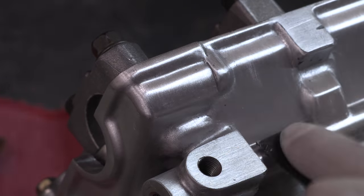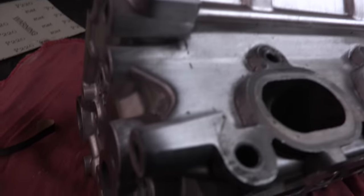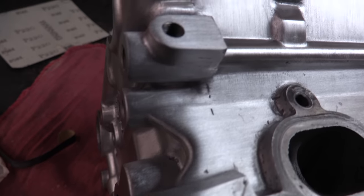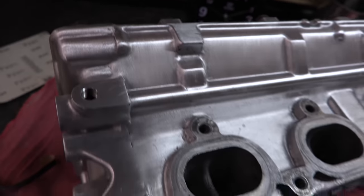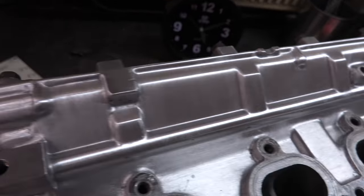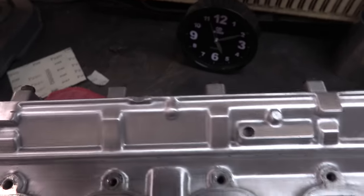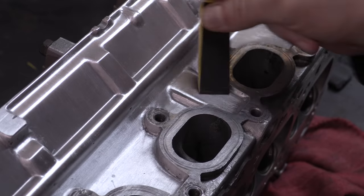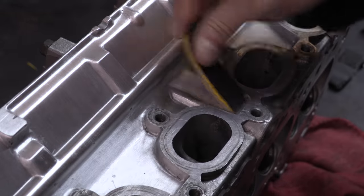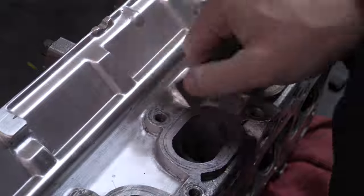You'll start seeing reflections. This is a fun cut if you've been waiting for something to start looking different than just a scratched-up hunk of metal. You learned how to follow the light in step 2. In this one, you're going to use the light to fix every edge of every intersecting angle and make all that stuff straight. Every flat face, no matter how big or small, gets sanded, but so do the corners and the edges wherever they meet. Any Swiss cheese holes, fish eyes, or imperfections in these areas that you leave behind after this cut — they're going to be in your final finish. The ones you spot you can usually take out with extra elbow grease, but the ones you leave become a feature of your part's personality, its character.